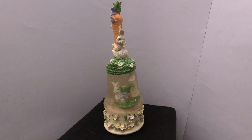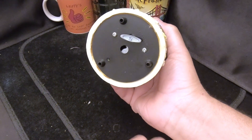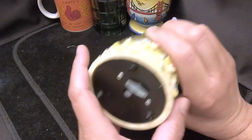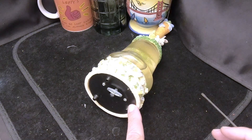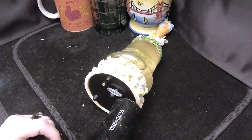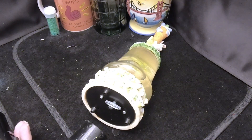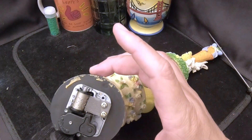All right, the first step is to take the cover off. As usual, these are normally put on with hot glue, so we're going to heat it up with the hairdryer to melt that glue and then pry it off. It looks like we've got some space to get the screwdriver underneath it, so let's heat it up on this side and see if we can get it loose. There we go — we got the cover off.